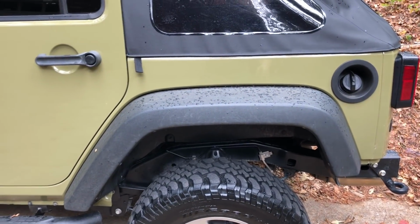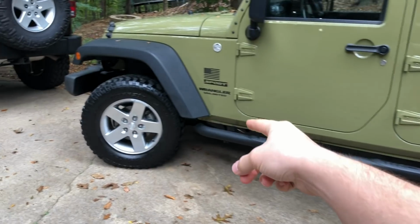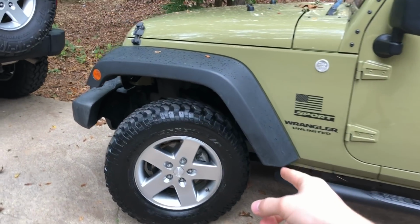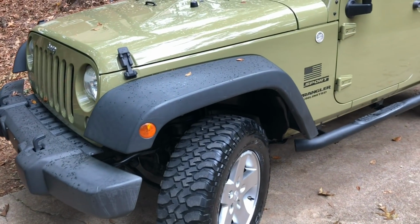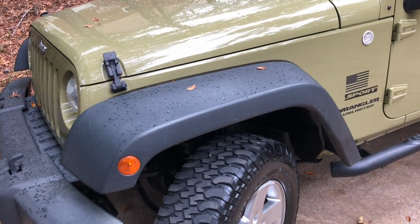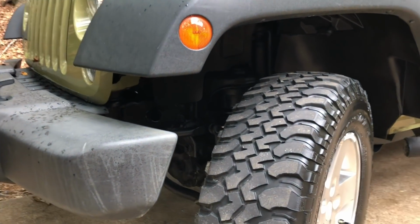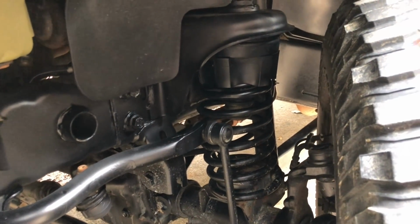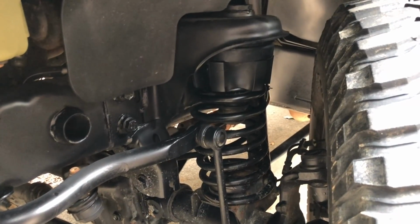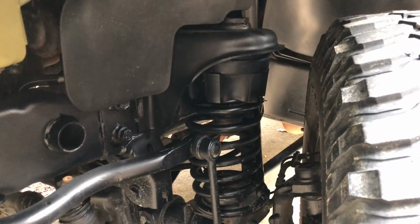But basically a rundown, we're just gonna be extending the brake lines, still gonna have stock control arms, gonna be adding control arm drop brackets for now. We are gonna be doing 3.5 inch coils and then 1 inch coil spacer to level it out, make it 4.5 inches like Glade was. But for right now, I think the coil spacers that we have in there are gonna have to do. So right now I'm gonna measure these coil spacers and see about what lift it has. Those will just be temporary, obviously.